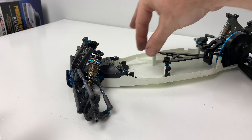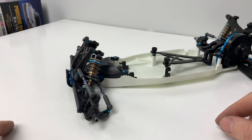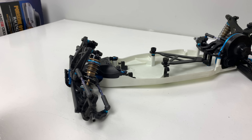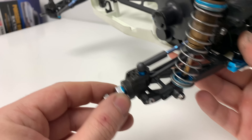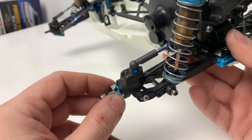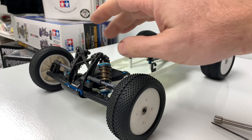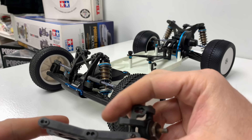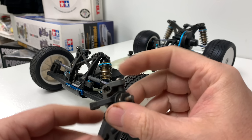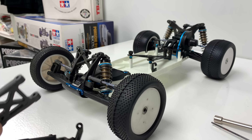Next thing — I want to dig out wheels for it. I've got a set of Tamiya 201 wheels with dual block tyres left over from something, so I need to dig them out. These have got hexes on the back, interestingly. As I'm taking wheels off the 201 to get the whiter ones, I've noticed something about the front hubs on the 211. Instead of messing around with that I'm going to try fitting the Team Associated arms and hubs I got off Dennis — the beauty of those is they take 12mm hex wheels, which is massive. I need to figure out how to change these over.